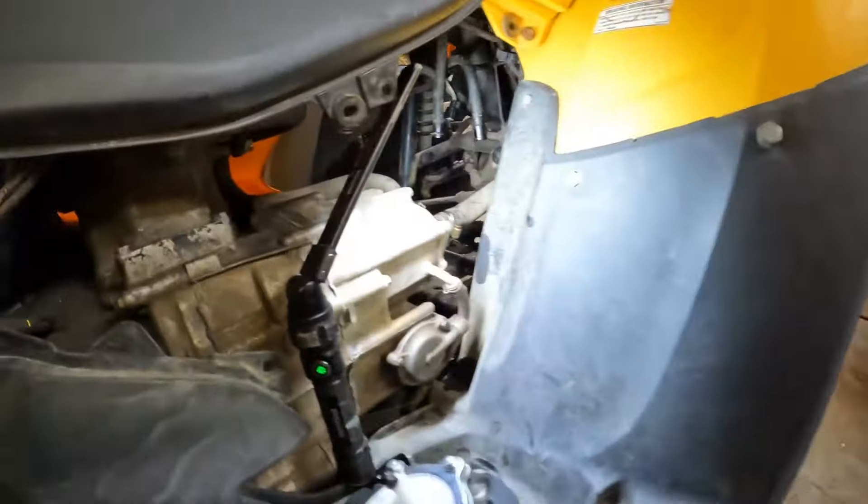This is a pretty easy one. I've had these sometimes where the pump is just weak — pressure low — and it'll still not run. I've actually had them where they still cut on and not shoot any gas out of the fuel line tying into the fuel injector. If you need to check that, it's up under this cover here — the fuel line hooks to the top of the injector right here. In this case the problem is this thing doesn't make any noise; the pump doesn't even run when you kick the switch on. I'll turn the switch on so you can hear it.